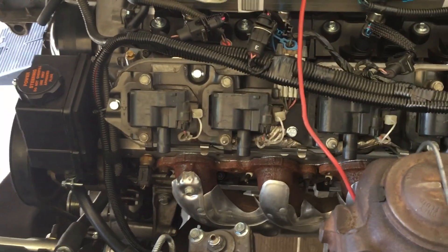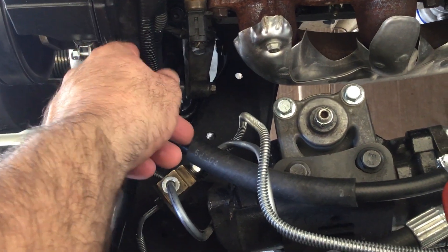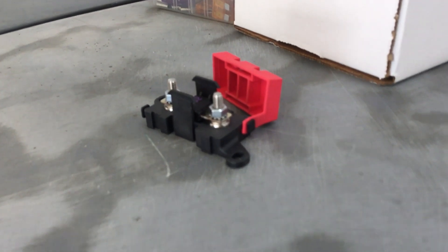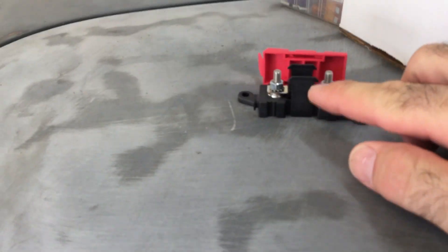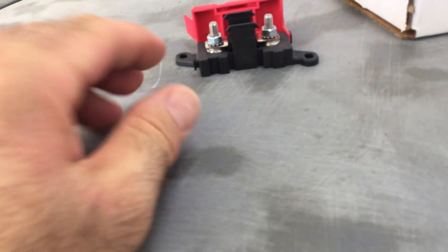Last week I cranked the engine over and tried to get a video out but ran out of time. I've been doing a bit more work since. I ordered an alternator wiring kit from Summit - the wire is hooked up to the alternator, coming up around and routing to the right rear side of the engine. I'm wiring in a mini fuse block: a wire comes directly off the starter lug, the battery cable attaches to that same lug, and the alternator wire hooks to the other side. Constant power for the computer ties in there too with a 200-amp fuse.